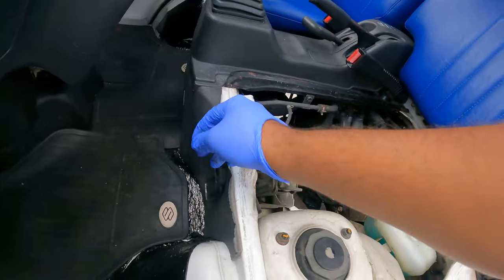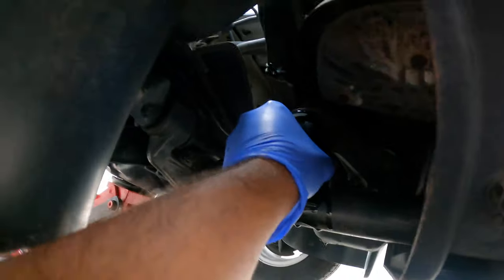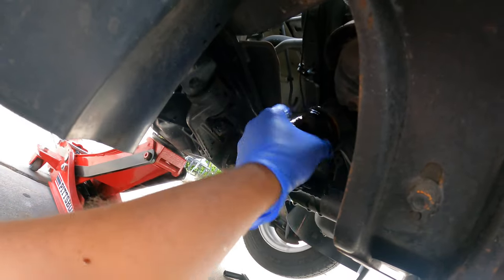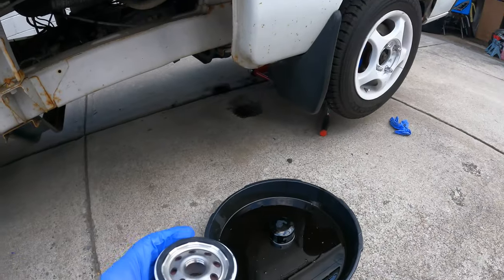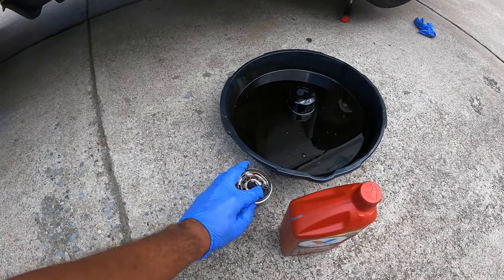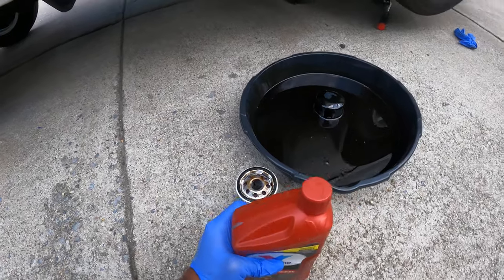Take out this seat — you just have to unclip this. And now we're going to loosen this guy and put him over here. Let's get this filter off. Straight from Japan. So now that the old oil is all out, we're going to take our new filter and do a little of this. Can someone let me know in the comments what this is? Like, what does this do exactly? I guess it lubricates it so it can stick on better, but I've always just seen people do that. And then we're going to add a little bit of this new oil in here so it's not completely empty when I put it in.